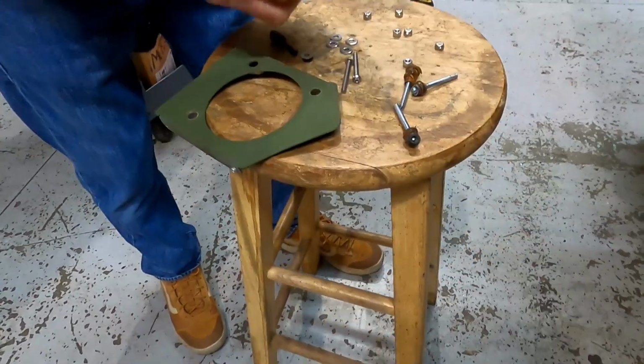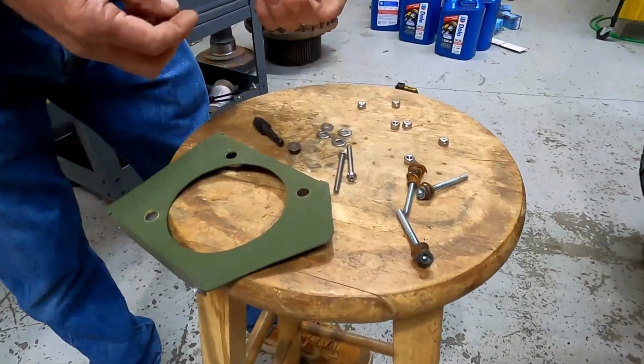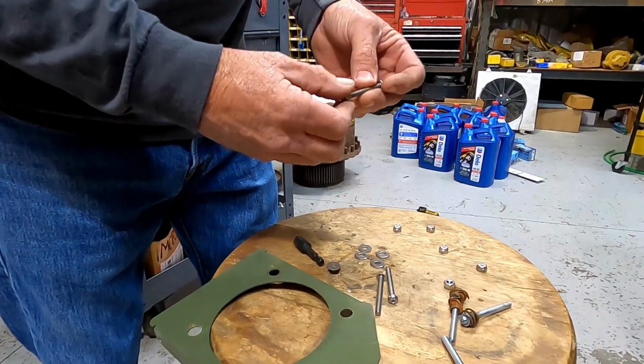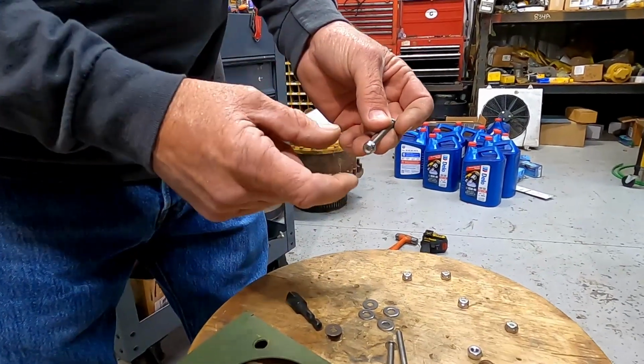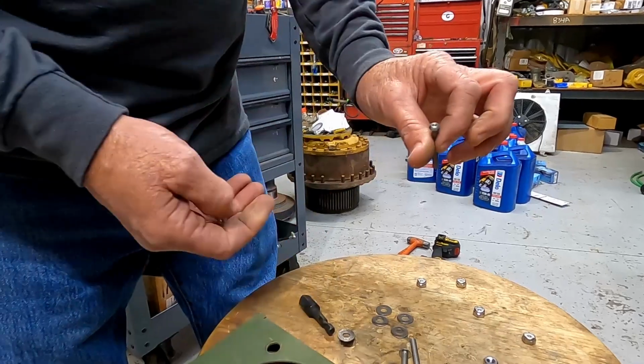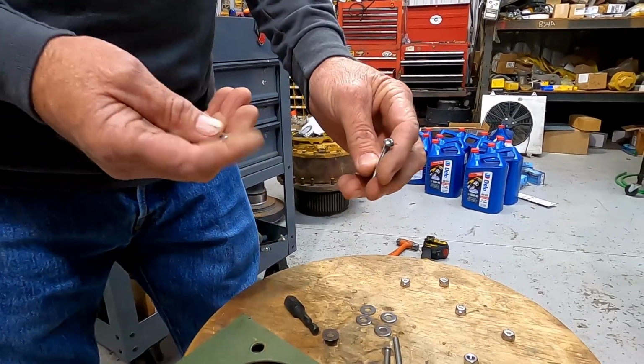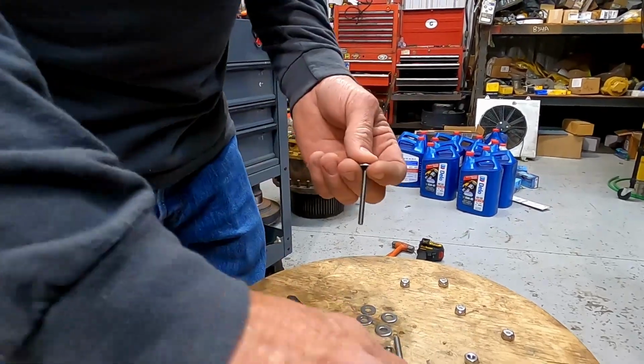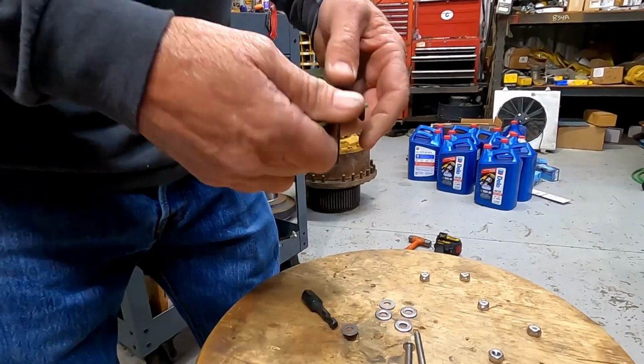All right, so what I do to replace it, I've got these screws. I had one grade of stainless steel screws and I had problems with them galling on the nuts. You wouldn't be able to screw it on halfway and they would just seize up on there. So I bought a different screw, and I can't tell you what grade of stainless it is, but you just have to be careful of that. You might even be better just buying a galvanized screw or something like that.